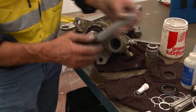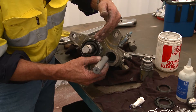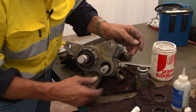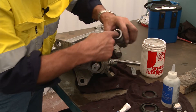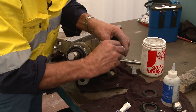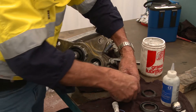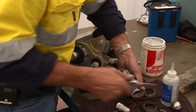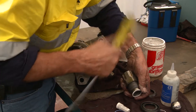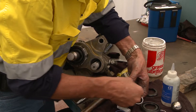I've touched it with vaseline — does it matter? Not really, because I still have to flush all that lubrication I put on the piston and packers. I can put this back in knowing I'm going to flush the whole thing with solvent. Push it home — remember the spring inside this cap has to be free and able to push into the seat. You can replace the o-ring in this kit. Using a knife, screwdriver, or hammer will just damage the ring land edge.